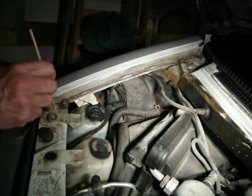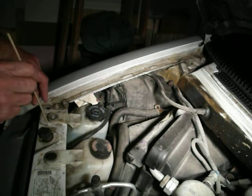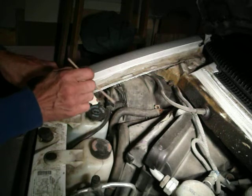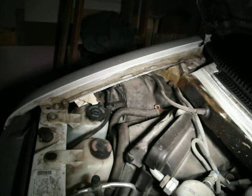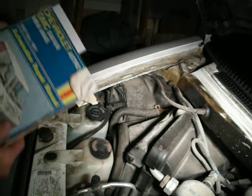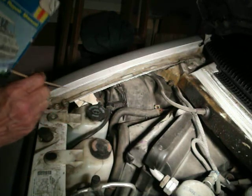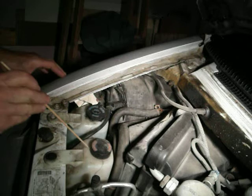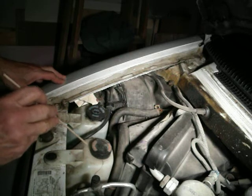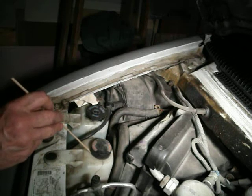So once this is out, you haven't damaged the pump on the bottom, you haven't hooked on the back of the headlight and broken anything. You take these 3 little screws out, and the whole thing comes out in your hand. One of the books suggests that you have to pull the squirrel cage fan off the motor before you can lift it out. That may be for some vehicles. If you tried to do that on this vehicle, you would almost certainly destroy something.